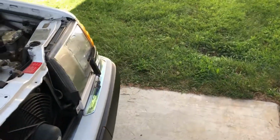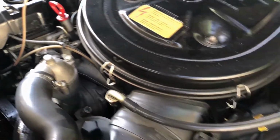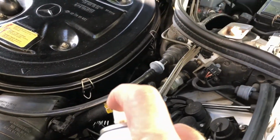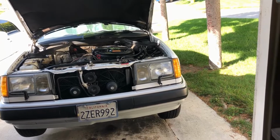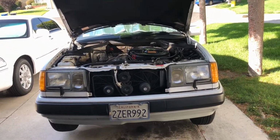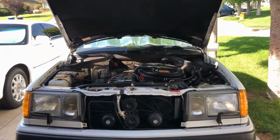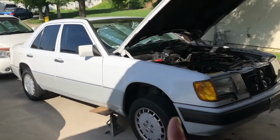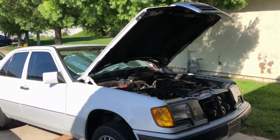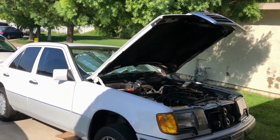So we're going to replace the radiator. I already ordered it, and a new fan clutch. Let that sit on there for a little while. Yeah, on my forum, some people say, take the radiator out, have it cleaned. I don't think there's any places that even do that around here. Have them test it. Well, if it's a 10-year-old radiator... and that thing's original. It's 16 years old. It's fine, but we're just trying to. I don't know. It was boiling coolant, so the flow is probably not that good. Maybe it's just got a little bit of scale and stuff like that in there.